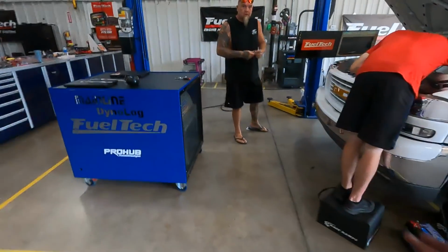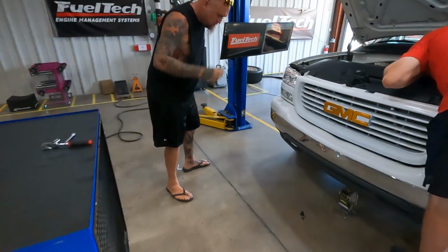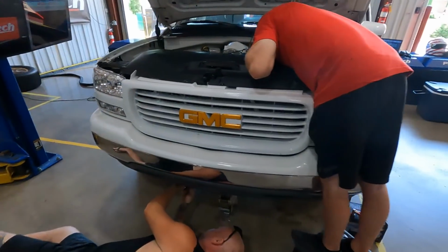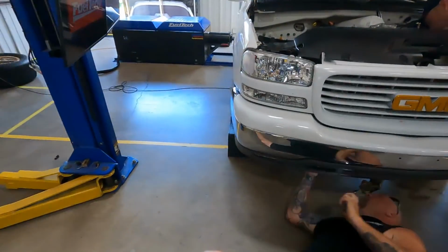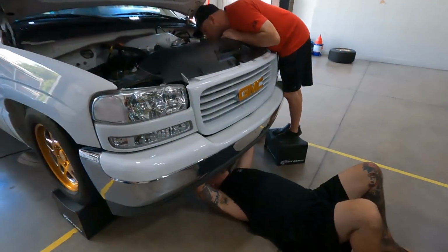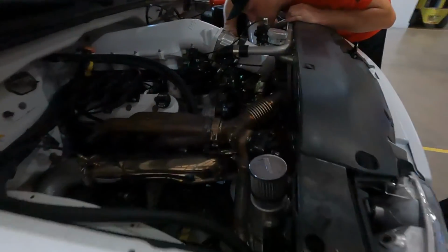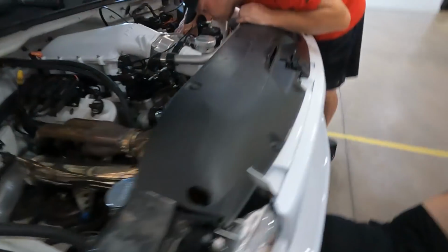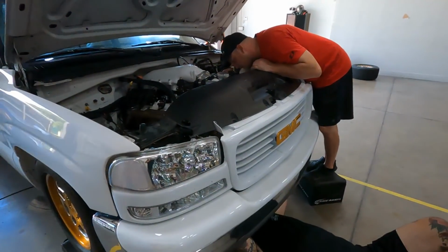Okay, so the current situation is we're trying a new crank trigger setup now. We went over to Proline, got an RCD missing magnet wheel. Sean got it put on for me, and now he's marking some timing numbers on my balancer so they can check timing here. I'm marking 20 on it and on the crank trigger.